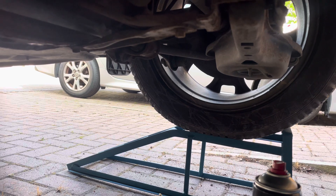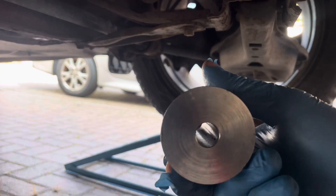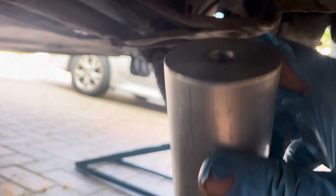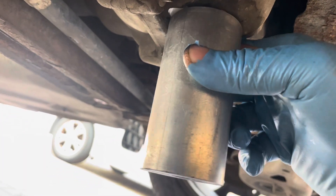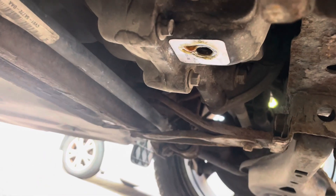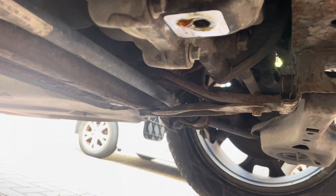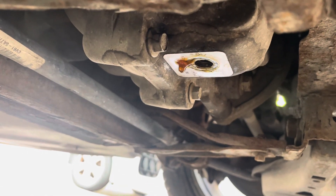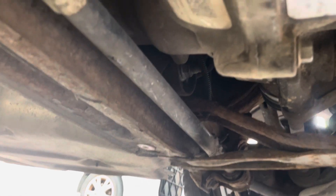Just to make sure I was drilling nice and square, I made up two guides: one for the drill size for the right thread, so I could hold it there and drill it nice and square, and another one just slightly bigger than the tap so I can tap it nice and square as well. It hasn't dripped at all in 50,000 miles.